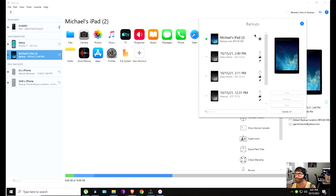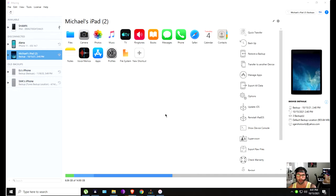Over here you can see the various backups that I've taken of his iPad. You can also restore from backup, which is great. So I took a backup, then I wiped — I disconnected the iPad from this computer, did the reset setting within iOS, and restored. The backup worked beautifully. It took the system storage from 15.5 down to 5.5 and it was exactly the way it was before. For any of you that run into that issue with iPads, take a backup, wipe it, and reload it and it works great.